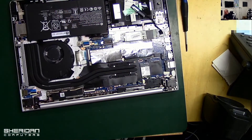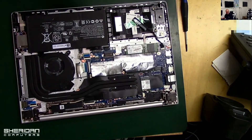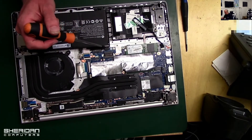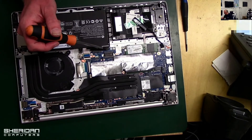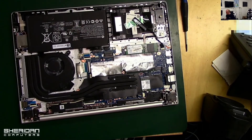Now that is basically it. If you do need to remove the battery for whatever reason, there's a screw here, one here, one here. This screw varies — sometimes it's a small one that doesn't need to be removed, but when it's the large one like this you'll have to take that out as well. Then the battery will just lift up.